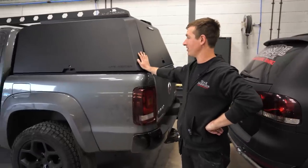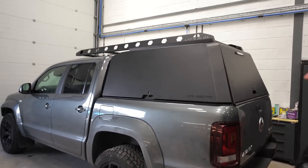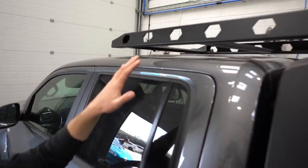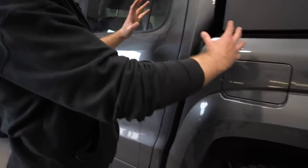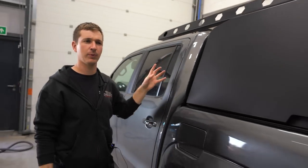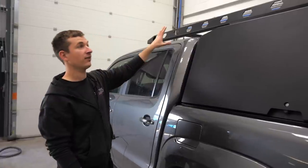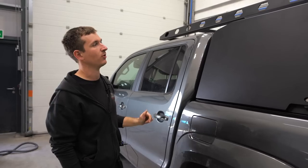Dave's managed to get the UteMaster canopy on — I think it looks sweet, really happy with it. It's a bit hard to see from this angle but you can see the roof rack is a cantilever design. Everybody keeps asking why it's like that — it's because the gap is intentional; if you put a ton in the back it's going to flex while driving. A few people in Amarok Owners Clubs have been saying that when roof racks go all the way forward they're snapping and bending, so that's why. We should still be able to get around 200 kilos on there, which should be fine for our needs.